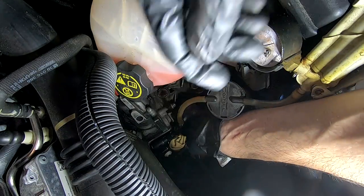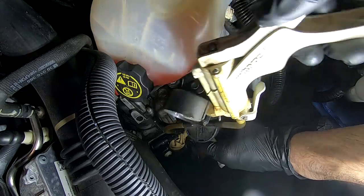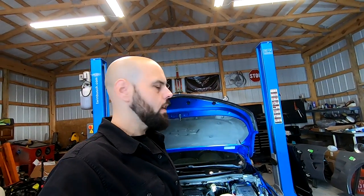I'm using a vacuum bleeder, exactly like what I would do if I were bleeding brakes — it's pretty much the same thing in theory. Once I put the new valve in and the linkage back, there was completely zero fluid in the system. I used the vacuum bleeder to pull the air out as much as I could, and then every time I pushed down on the pedal the pedal would just shoot to the floor and get stuck. What I found easiest is to push the pedal halfway — before the spring helps you — and then back up again. Do it like 30 times, and you'll notice when you push toward the spring it won't pull the pedal anymore. The clutch starts to feel normal, and then you probably want to push it a total of about 100 to 150 times. Let's put the car all back together and take this on a road test.